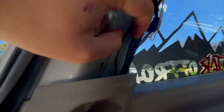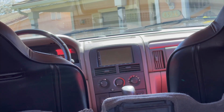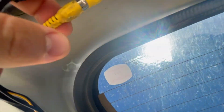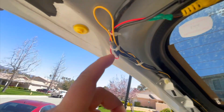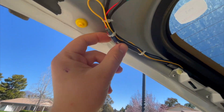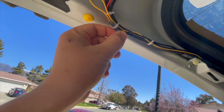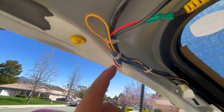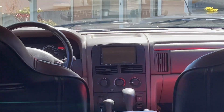This is for the power — I ran it from the purple wire with the black stripe and then the black wire for negative ground. You could get ground from the chassis itself but I wanted to run direct power to it. This cable goes to the radio — on the back of the radio there's a connection called RCin, which I believe stands for Rear Camera In, and I connected it there. On the cable from the radio there is a red wire and you want to give that red wire power, so I connected it to the positive for the reverse lights as well.